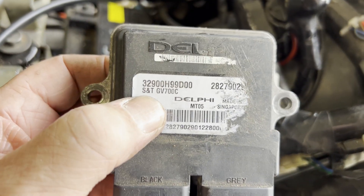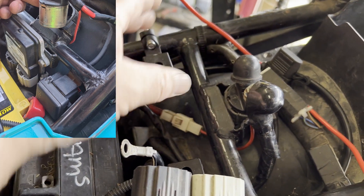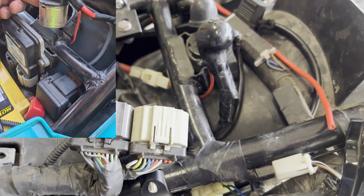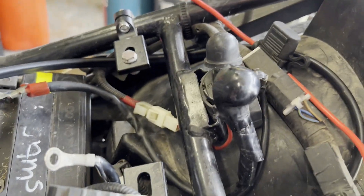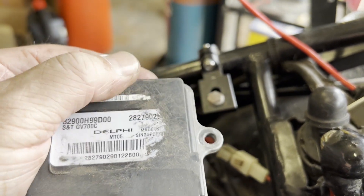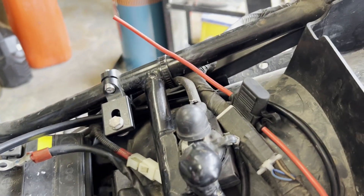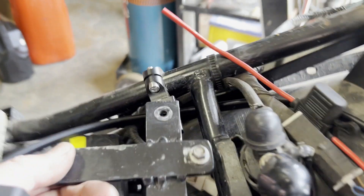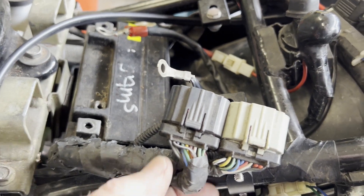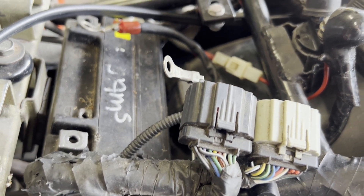This ECM is a Delphi unit and it's even got 'GV 700C' on it. Technically the ECM should have bolted up with a flat plate right there, but there's no provision for that — nothing's been ground off. Someone just had it flopping and hanging down, which is why it's all scrubbed off. I changed it up and put a cross bracket in to hold it in place; the ECM goes across like that, plugs in, sits up with plenty of airflow and doesn't foul the seat.